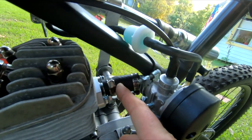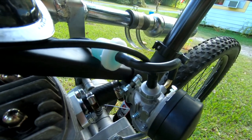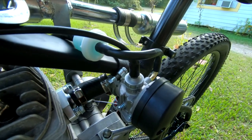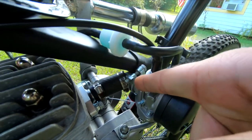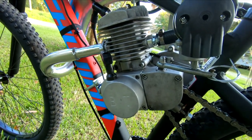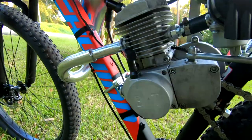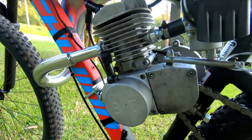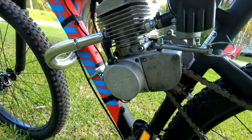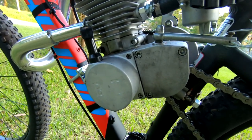Here we've got heater hose, hose clamps, and an old offset intake from Amazon or eBay — it's junk, but I chopped it and used it as a mount for the carburetor. This is the third style of pull start I've found so far — in my opinion it's the best design. It says BT on it, so I assume it's for the BT80s and BT100s. It's not perfect — the one tooth designed to grab onto the pulley is plastic and you only get one of them — but everything else looks really well-made, so hopefully it'll last.